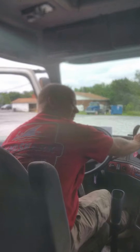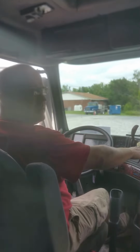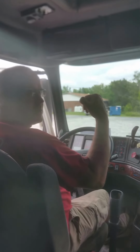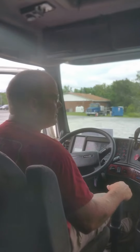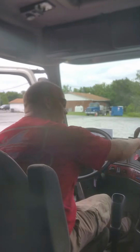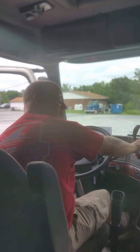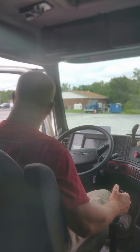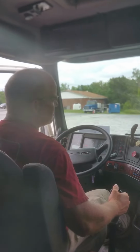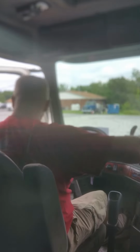If I push my yellow valve in, which brakes am I releasing? I'm releasing the tractor brakes, right? Trailer brakes are still on, so I'm checking the trailer parking brakes. All I'm going to do is ease out on the clutch, nice and easy, make sure it doesn't go anywhere. Then I'm going to switch it up. I'm going to pull the yellow one out, set the tractor brake, push the red one in, release the trailer brakes. Same thing: I'm going to ease up on that clutch, nice and easy, just to make sure I don't go anywhere. Then I'm going to push both buttons in and check the service brake, make sure you're clear.